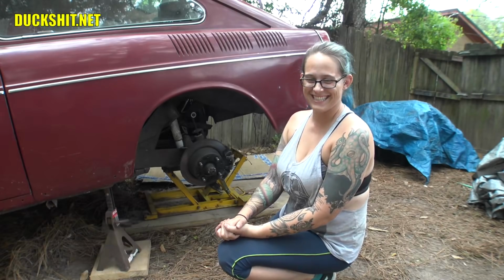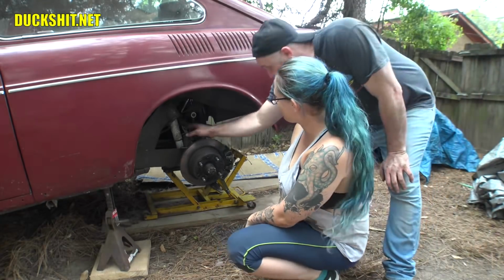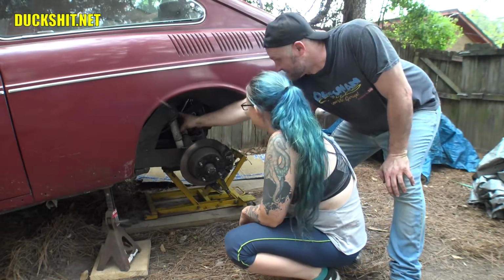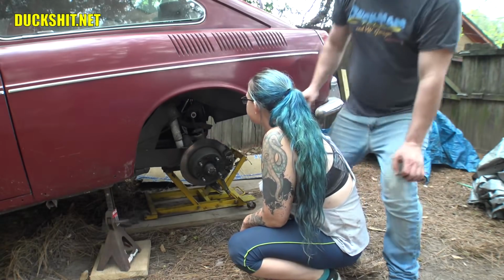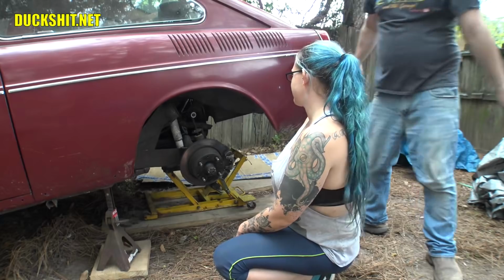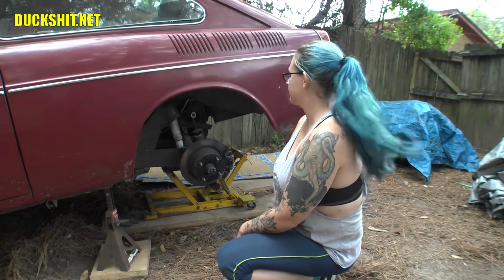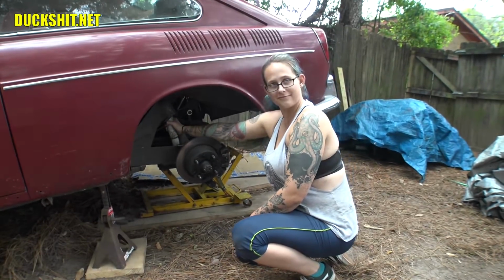All right, well, we got that wheel off of there. Now, down below here is the wheel hub and the shock absorber. The last body bolt that holds the subframe on is actually right up under here. You see it up there? Yep. It's in a goofy spot, so this shock has to come out. Mm-hmm. It attaches on the bottom and the top. They're probably going to be 17 millimeter nuts. Yeah, there's wrenches around here somewhere. We'll get it for you. And you can pull that shock absorber out, that big white stick that you see standing vertically. Yeah, you got a good grip on that. And, yeah, that needs to come out.